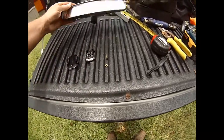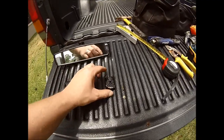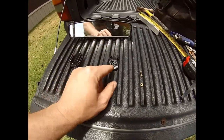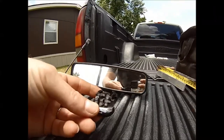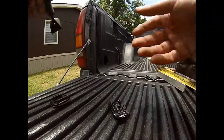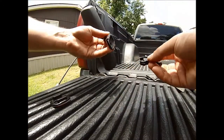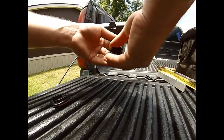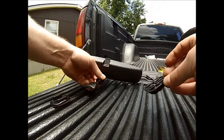What we're going to do here is a GoPro modification to this rear view mirror. What I've done is I've chewed this little clip up pretty good with a grinding wheel. The reason why we did that is because we're going to attach this part here, using the existing location for the old screw.